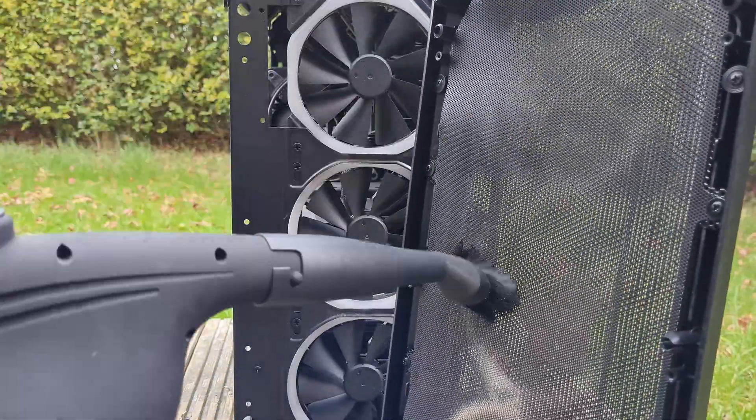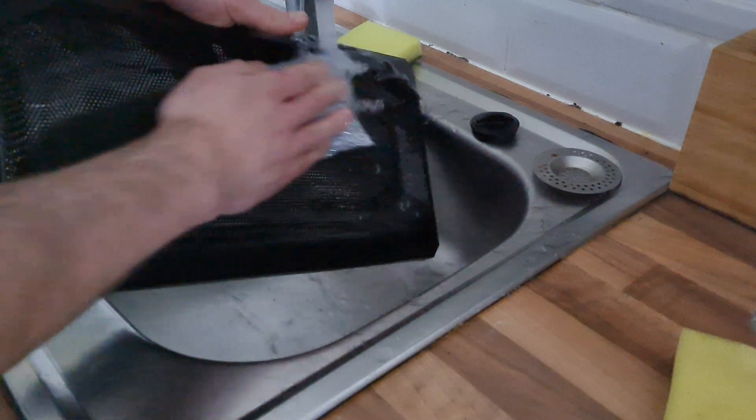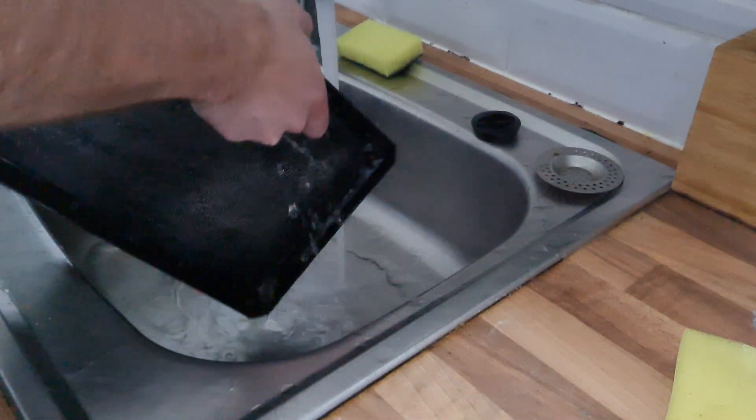You've actually done quite a good job of making this PC look a lot nicer just by dusting it out. But if you've got really stubborn dust on case components like the case panel or fans, you might need to get a bit more aggressive — we're going to be using water. Now it's always said don't put water near PC parts and to an extent I agree, so there's no way I'd run the motherboard under a tap. But things that are inert and don't have any electrical signal going through them — like the front case piece — absolutely give them a run with a soft sponge and some warm water. Just make sure you leave it for a long time to make sure it's bone dry before putting it back on your PC.